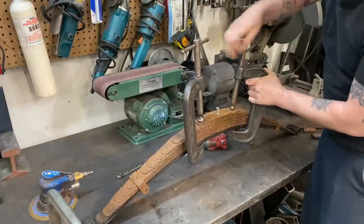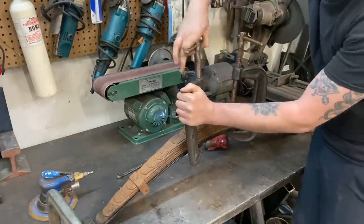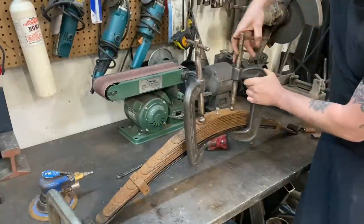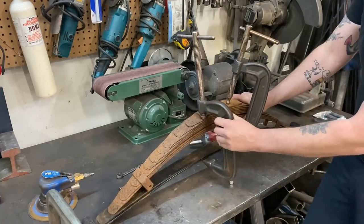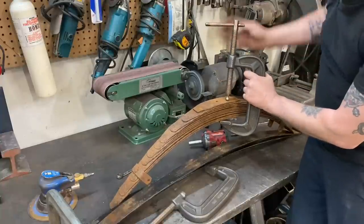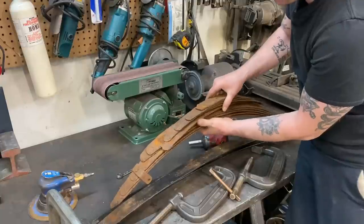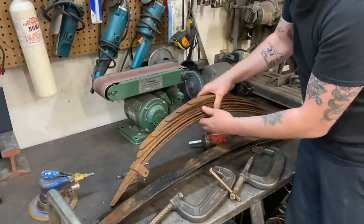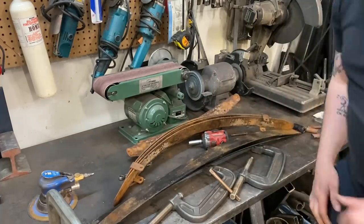Okay, whatever. Loosen them off a little bit and the tension will slowly release out of the spring until the point when it's not under tension anymore. Okay, there we go. Our spring pack is all apart now. So we'll clean and sand in between all of these, paint everything, and then put it back together with the original springs.